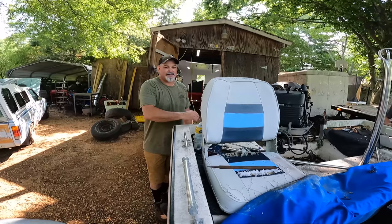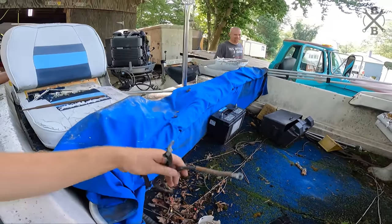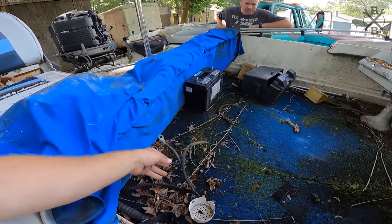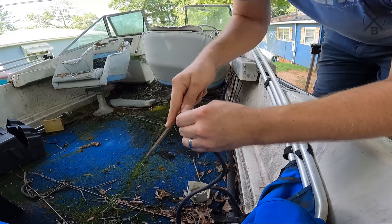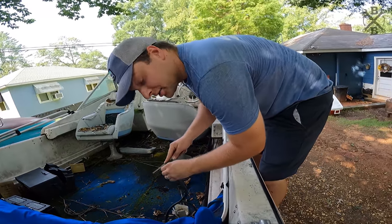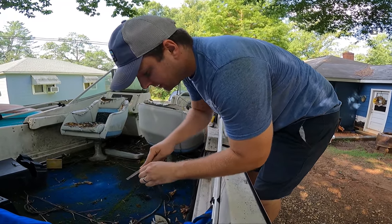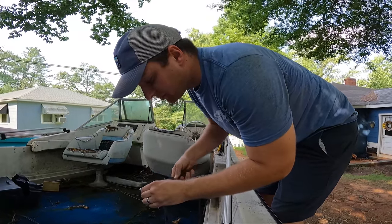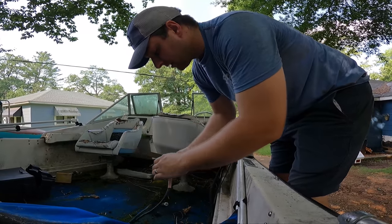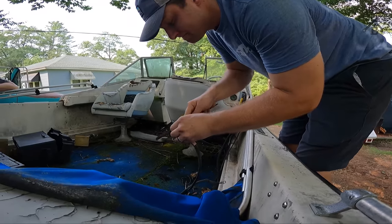All right, so we've got a battery. Hank doesn't want me to, but I'm gonna clean up our terminals because they're looking a little crispy before we stick this battery in here. On a lot of your older boat motors, if you don't actually turn the right RPM when cranking over, it will not fire. So it'll give you a false reading when you're checking for fire. So we want to do everything we can to verify. Get enough juice. We might need, yeah, we have enough juice.